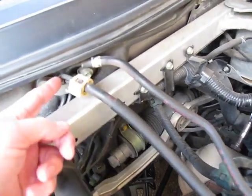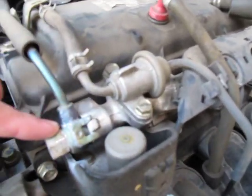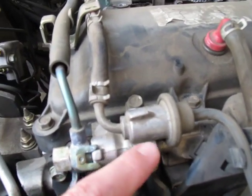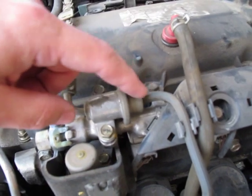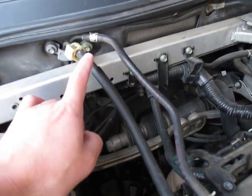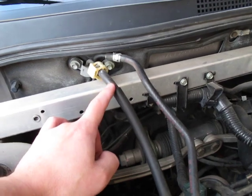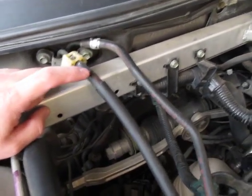Here's the fuel line right here on this car. This line is the fuel line - it goes into here and then connects to the fuel injectors. I believe this recirculates the gasoline, keeping it circulating back into the gas tank, and it's vacuum controlled. My plan is to bypass this so the valve does not open and does not allow gas to go back to the tank. I need to reduce the pressure of the gasoline, because high-pressure gasoline does not want to vaporize. Gasoline vaporizes at 400 degrees - that's what we want to reach.